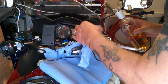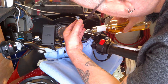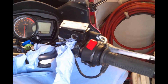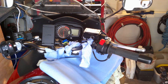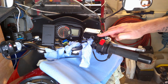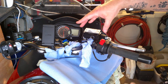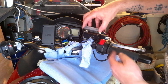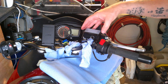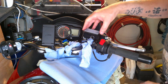Topping it up again, taking care. Depending on what kind of bike you've got, sometimes when you pump and release, the fluid moves up and down — it's just that I know this bike well. I could actually leave the cap off altogether, but because there was a little bit of fluid underneath, I'm letting it drip back in rather than drip on the bike. If it's your first time doing it and you're not sure, just keep it covered so fluid doesn't spit up onto your tank paintwork — this stuff is not good for paintwork whatsoever.